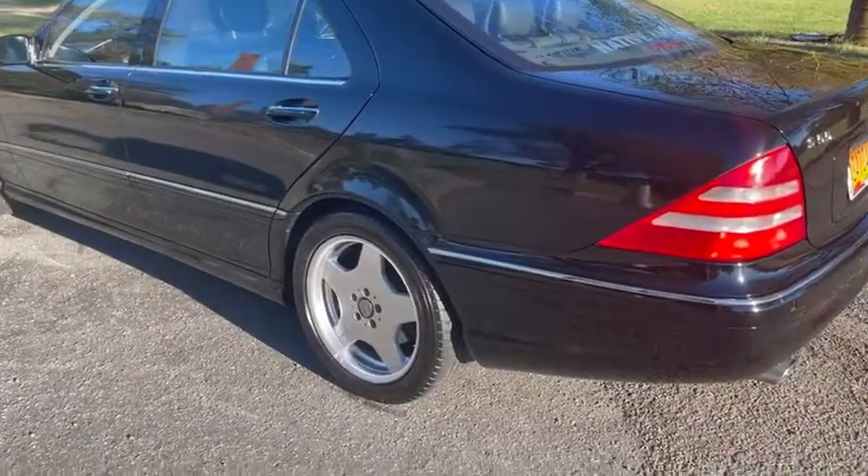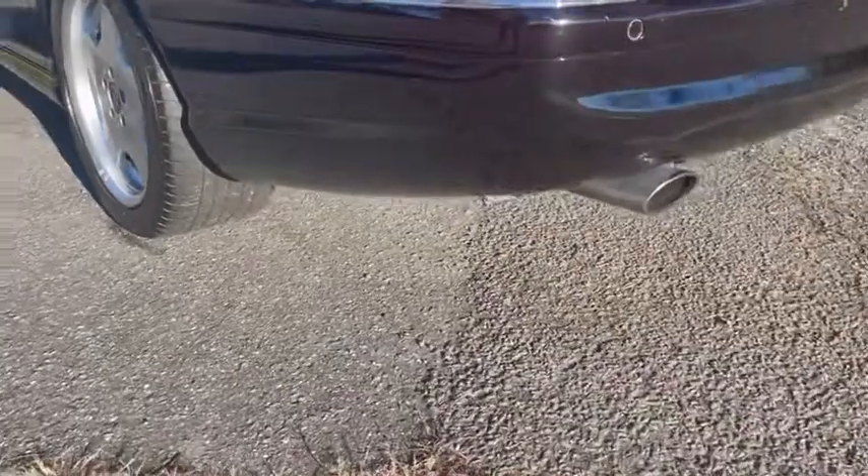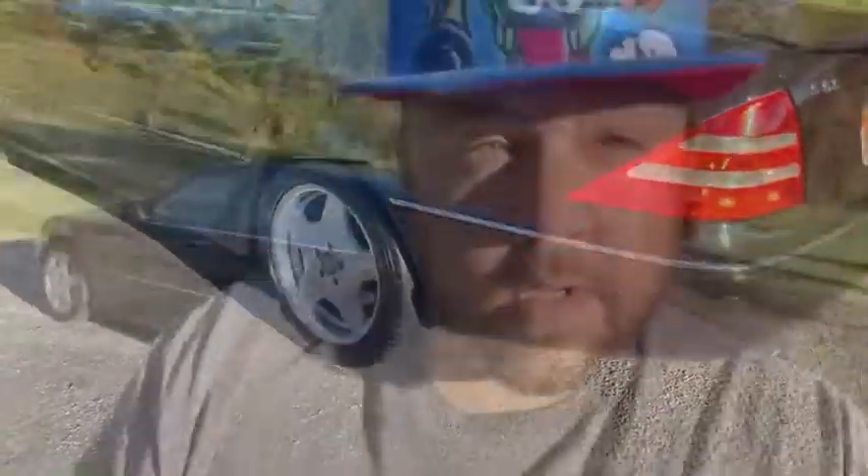Especially here at the rear of the car, there aren't any jacking points to kind of see. A lot of people actually just end up jacking up the car with the rear differential. Since this car weighs so much, I don't feel comfortable doing that. I just really strongly suggest jacking it up on the sides here, and if you have two jacks or something like that, just kind of raise the rear up — just to be extra safe because this car weighs so much.